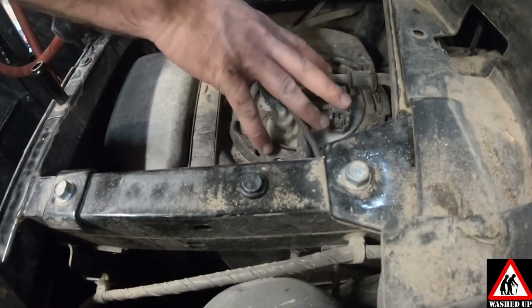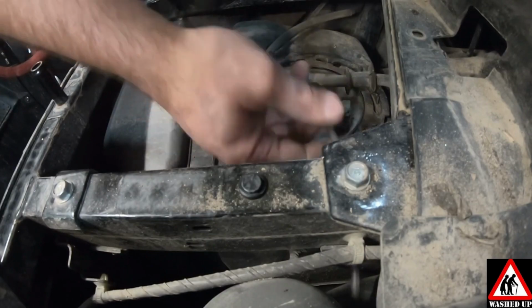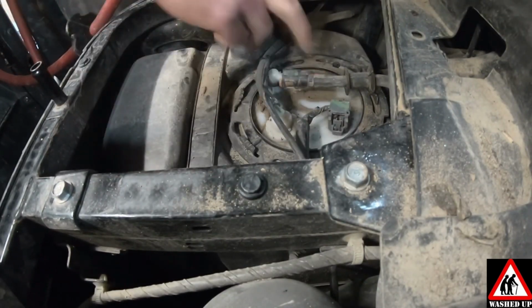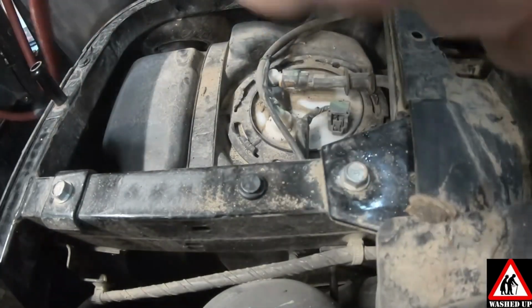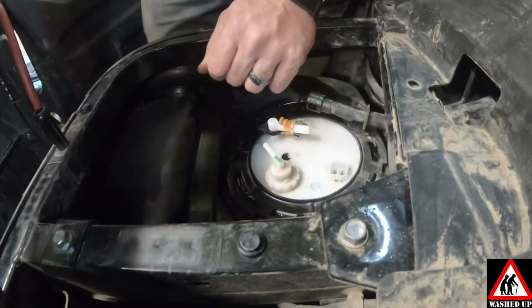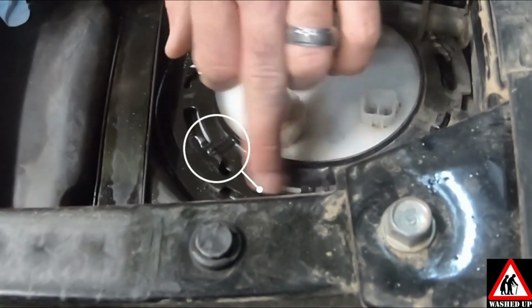So, fuel pump's right there. Of course, got wiring here, vent line right here. There's the vent line to the subtrans, but anyway, fuel line here. So, got that sand from all that creek riding. Definitely don't want any of that issue. So, air line out here. And of course, you're just gonna spin this ring. These little keepers right here. Once you spin past that, they'll get out here in this white part, slide right off.